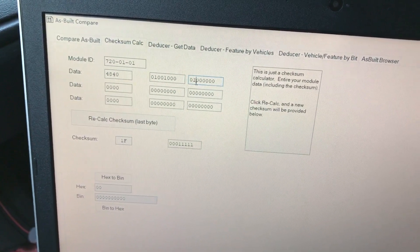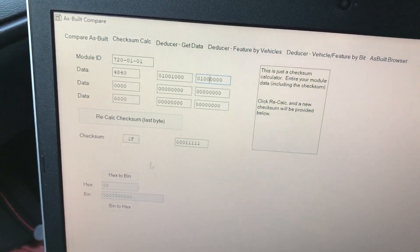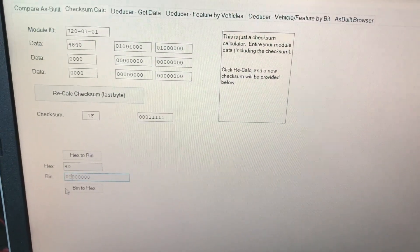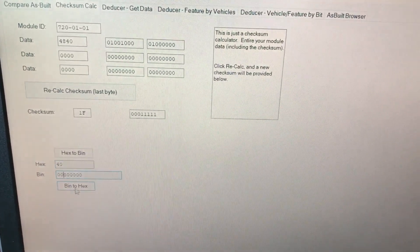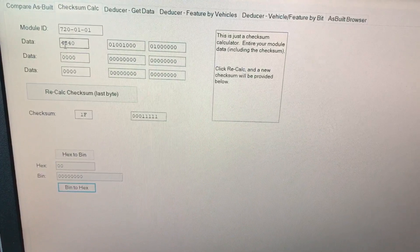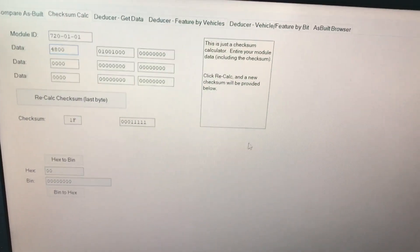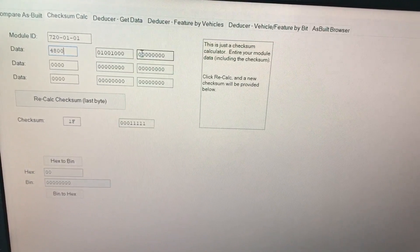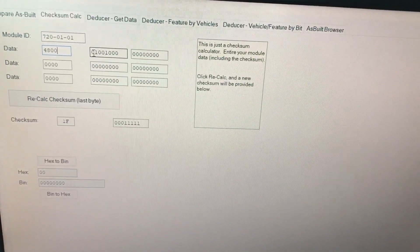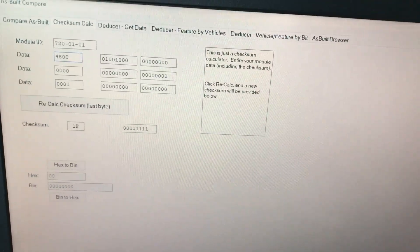The purpose of this is I'm going to change this one to zero to disable it. So just copy this number here. If you want to disable this, change it to zero — simple. So if you change to 4 8 0 0, then you can see here all zeros — you've disabled the air suspension function. This group's number is going to remain the same. So you're going to change to 4 8 0 0 on your FORScan, program it to zero zero, and then just write it like I showed you earlier.